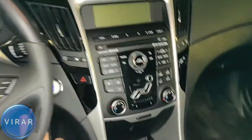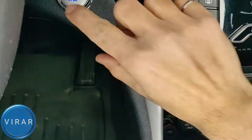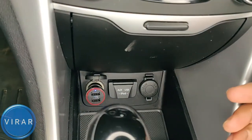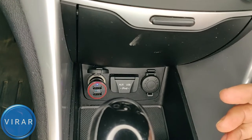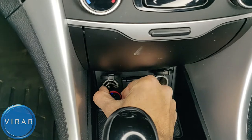In this video, I'm going to show you how to fix those power outlets on your 2011 to 2014 Hyundai Sonata. It's a very easy job. Most often the problem is a bad fuse, and luckily your car comes with a spare fuse and even comes with a fuse puller. So the whole process only takes about two minutes.